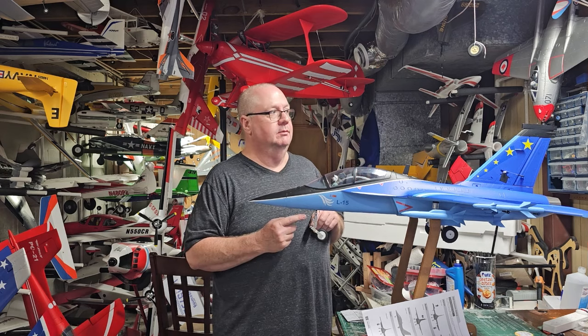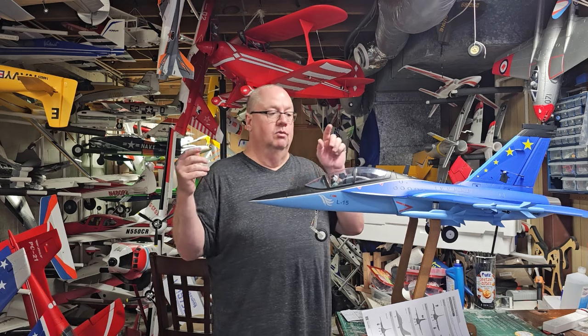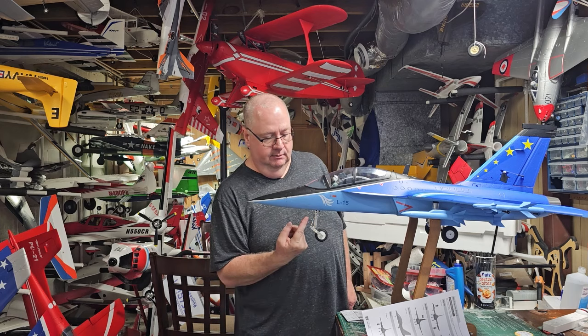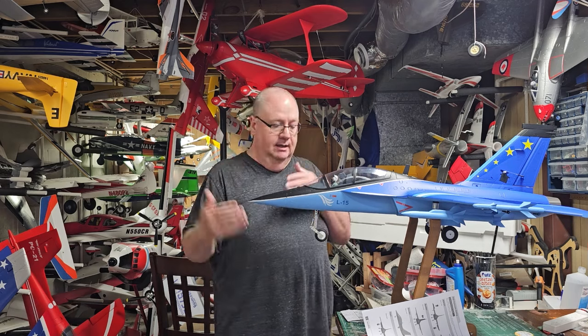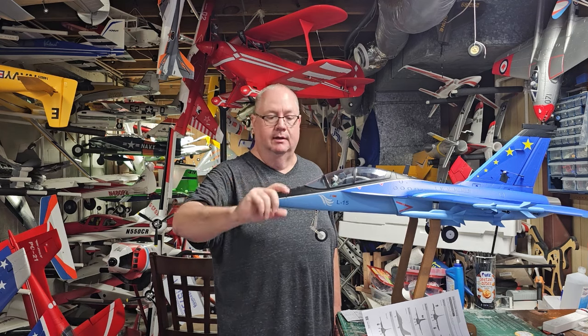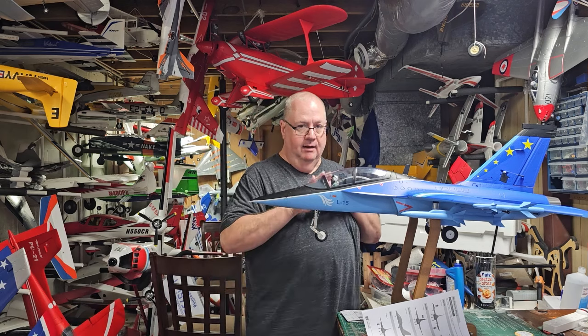I put it together — y'all watched the unboxing and the build video. There's a little pin that is supposed to come with it. I bought the 6S version with the upgraded gear. It comes in two sections: plug and play on 4S, and plug and play on 6S with upgraded suspension. I opted for the upgraded suspension, but the nose is supposed to have a little metal pin sticking out of the top that you shove into the little post hanging down, with grub screws that tighten up to it for a working nose gear. Mine didn't have that pin, so I had to manufacture my own pin out of an old Allen wrench, made about an inch long. I used an Allen wrench because they have flat places already on them where the grub screws attach, so now I've got that accomplished.